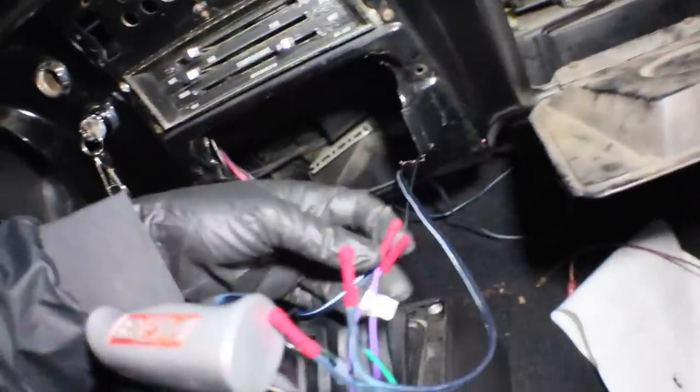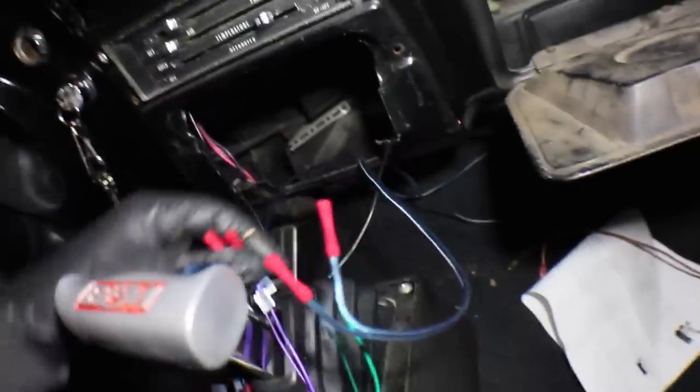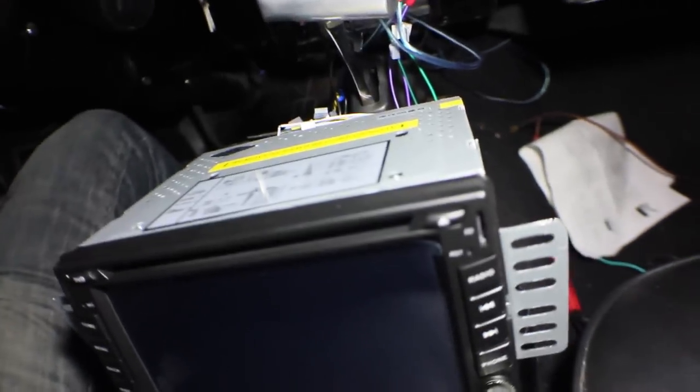Anybody who's trying to do this at home: grab the top back seat and just yank on it, push in that way, then up and then out. It's stupid. Pulling 45-year-old back seats out — that's a hold-your-breath type of situation. Ran the wire down along the floorboards and under my dash. Those blue wires are our rear wires going up to those speakers. Next step: I'm going to wire up the speakers in the back to the wires I just ran and then run them into the dash. We got the rear right and rear left all wired up. These wires are running back underneath the carpet into the stereo. We tested it — this was the first time I was able to wire up the Bluetooth with my phone and play through it, and it worked out great.